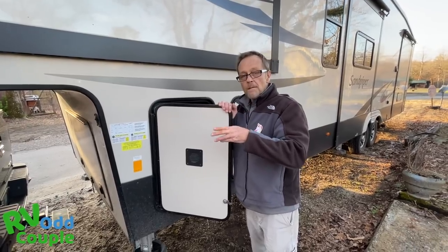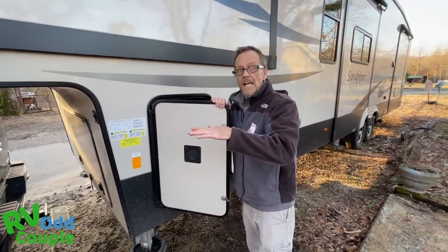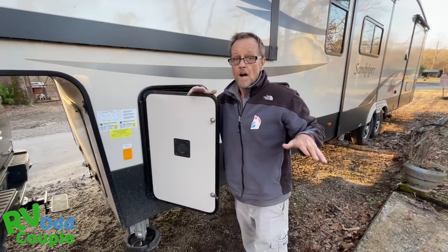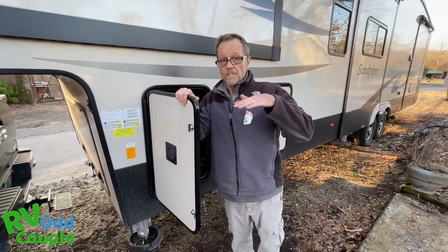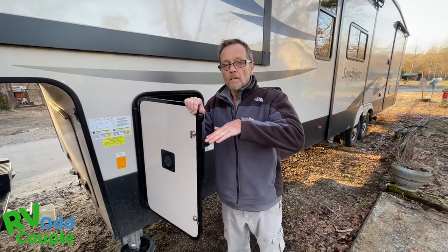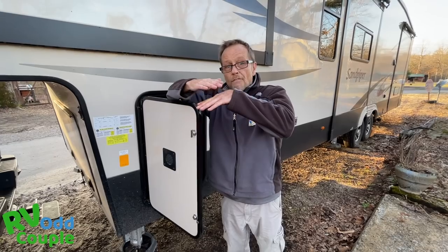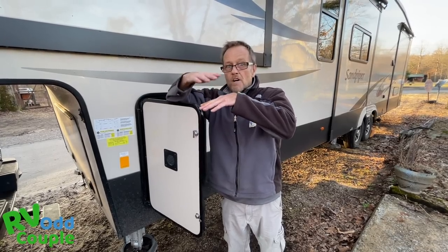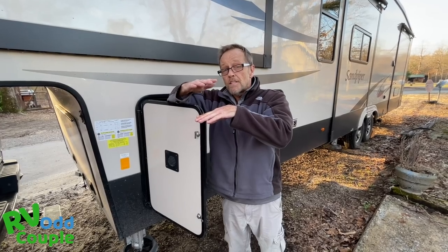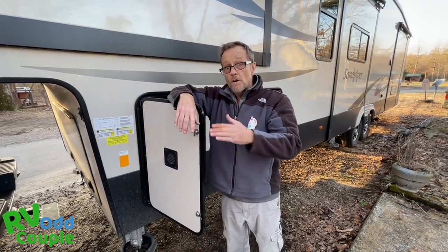At this point, I could take Mercedes, the baby, and the dog into the RV — it's not quite level but it's safe. The proper order to do this is: chalk your wheels, lift your RV — not completely, just get the weight of the RV off the truck. You don't want to lift the rear end of the truck before you detach. Drop your landing gear just enough so there's a little bit of space and no weight left on the truck. Then you're ready to go to the next step.